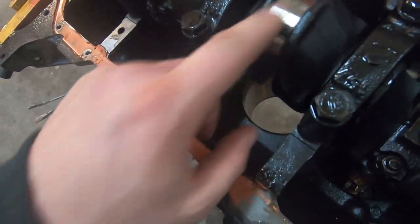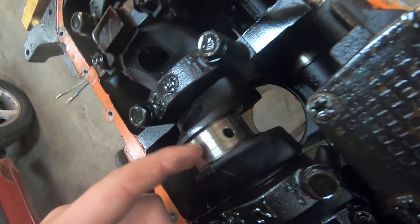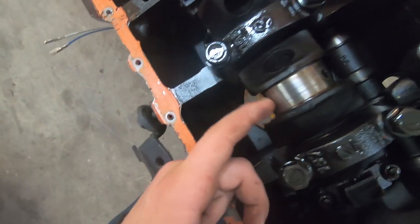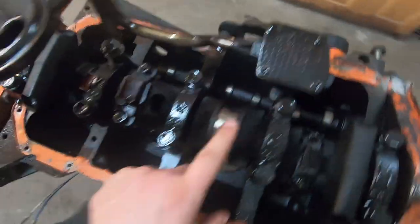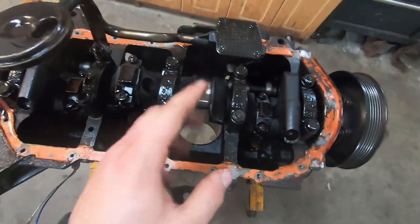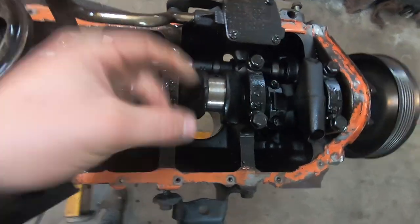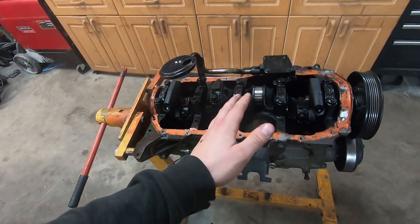How's the crank journal look? Oh it's fantastic. There's some scratches on the crank — like it's nowhere close to perfect. You can see just how weak this crankshaft is. Look at how they have these holes in here for balancing — there's no structure to this crankshaft. The fact this took 18 pounds of boost and didn't blow up is mind boggling to me.